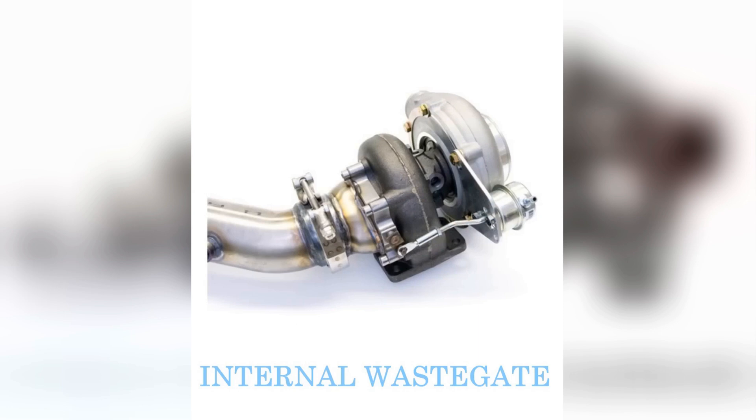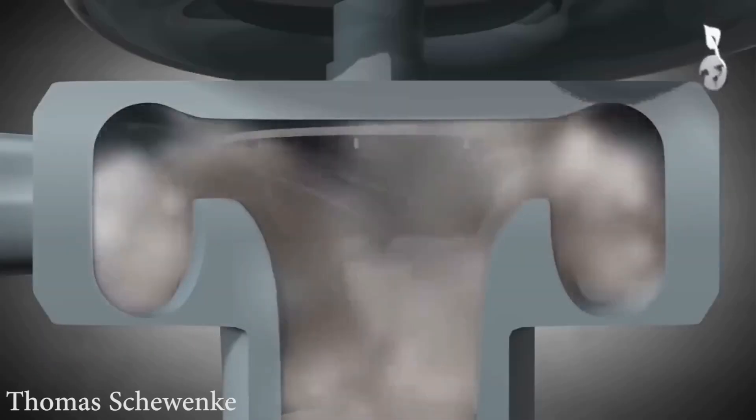The mechanism you've just seen is an interior wastegate, meaning it is a wastegate that is built into the turbo itself. However, turbocharged engines can also have external wastegates that are distinct from the turbo. So we keep stating how the compressor will raise its air pressure, but how does it do so? To fully comprehend how the turbo produces pressure, we must disassemble it.